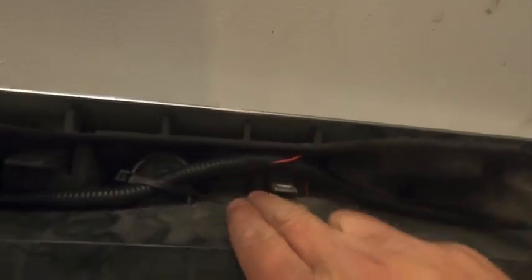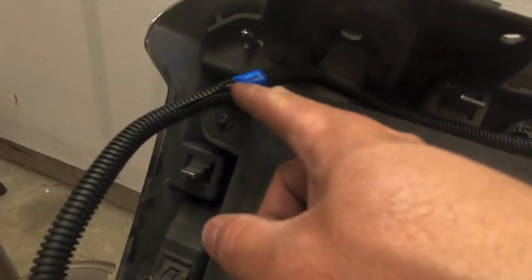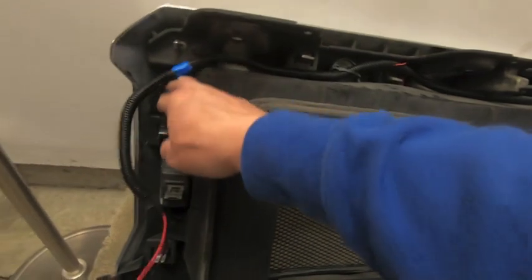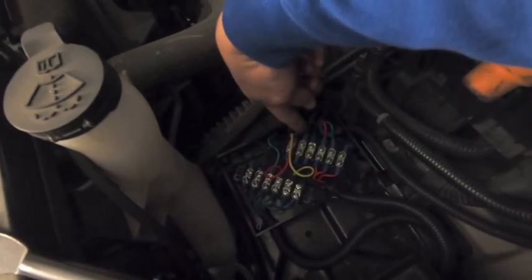I just finished up wiring. You can see the backs of the lights in there — one in the center, one to the far side, one here. I took the wires right out of the light and tucked them up on the grille. There's a rubber gasket between the inner and outer grill pieces, so I pulled the wires up through there. I wrapped them in loom, connected them, and terminated all the wires into two wires via butt connectors that'll run into the light control panel. On the GMC there's plenty of room to run it down the grill, behind the headlight, under the brace, and into the box where I'll tap into the DRL circuit and grab a ground.